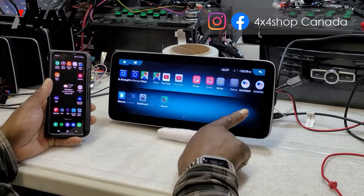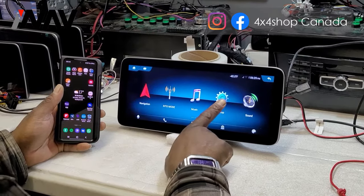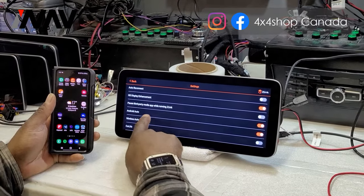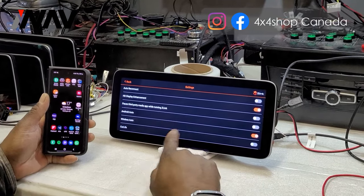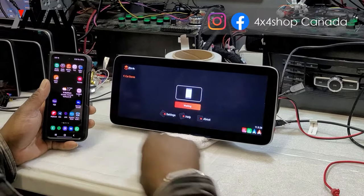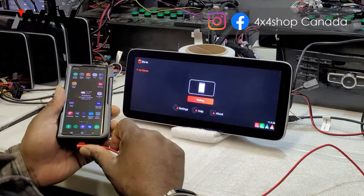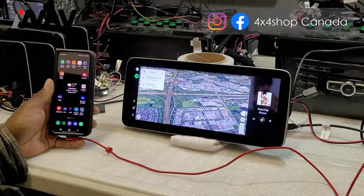You can go into apps and look for the Zlink app, which is going to be on your home page. Sometimes you will need to go into settings and check to make sure Android Auto is activated. If Android Auto is turned off, it will not make any connectivity to the system. Android Auto has to be activated. Then get a USB charge and sync cable — it has to be a certified charge and sync cable. If it does charging alone, it will not connect to Android Auto. That is the simple connection for getting Android Auto supported.